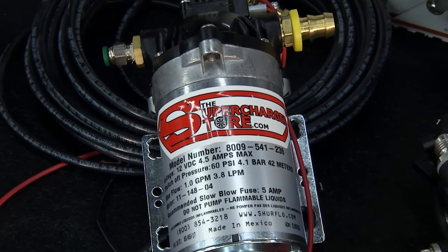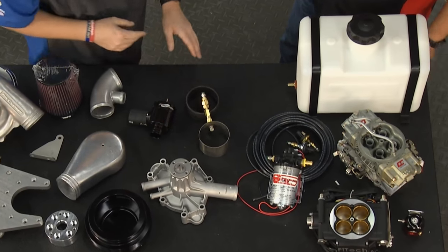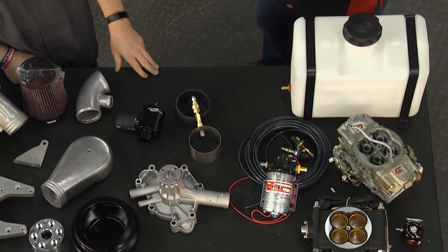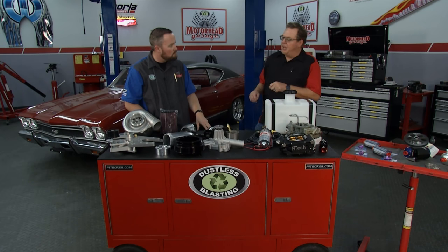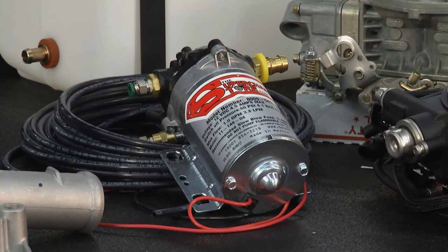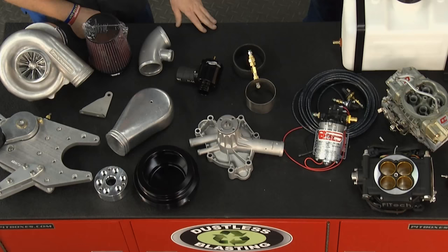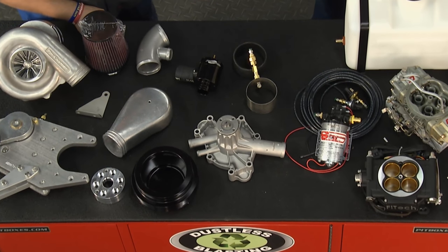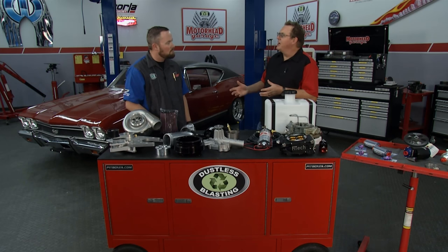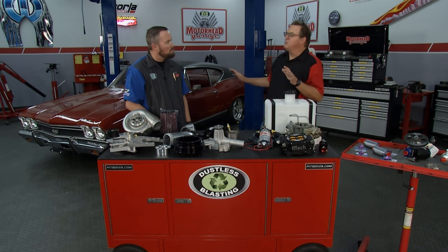In the case of making boosted horsepower, we need fuel. Carburetion and fuel injection — do you offer both? Well, we do offer both. As part of our kits, we offer custom-built blow-through carburetors — this carburetor has been modified, custom-built by a supplier of ours, to accept boost and run very consistently over all stages. We can either intercool these systems or we can use water-methanol injection. We've been doing water injection since 2003. You get two great benefits: it cools the charge air going through the supercharger, and it slows the flame down in the chamber, keeping you out of detonation. These water injection systems are designed for the guy who doesn't want to cut up his classic car — you don't have to go through the core support or drill big holes. With these kits, they could literally be taken off and the car is completely back to stock.